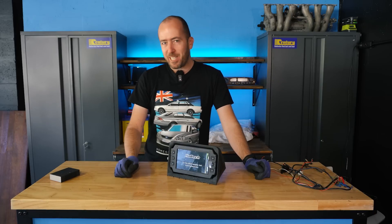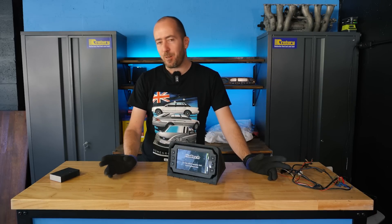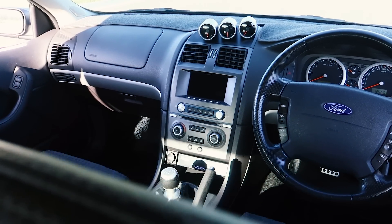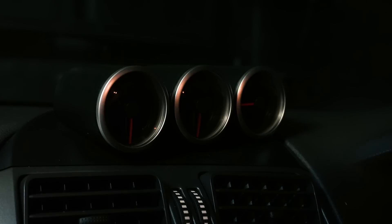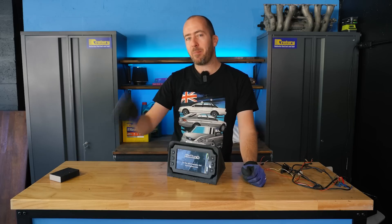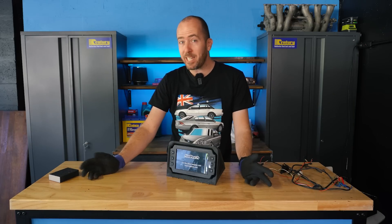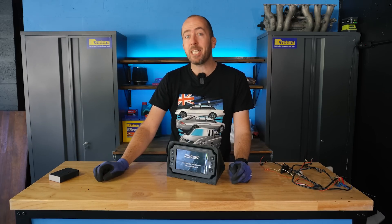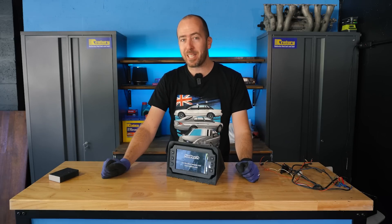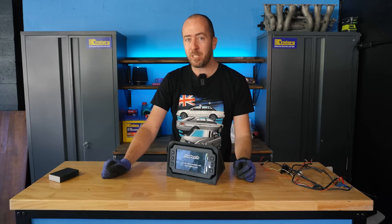What is actually going on here? Well, my BA XR6 Turbo has a triple gauge cluster on the dashboard and I found out it doesn't always give you the most accurate information. For example, on the boost gauge, it'll say that I'm hitting about five pounds of boost, but in reality I'm hitting boost cut at 23 pounds. It is really important with a performance car that you're getting accurate information.